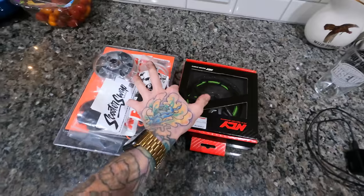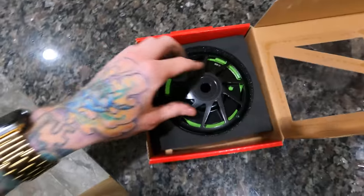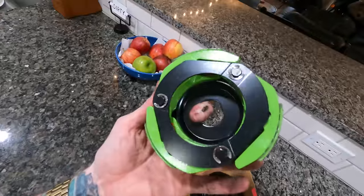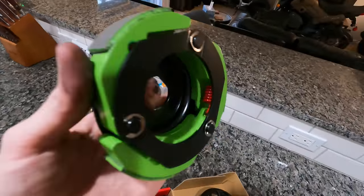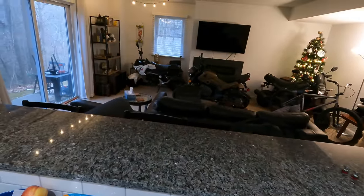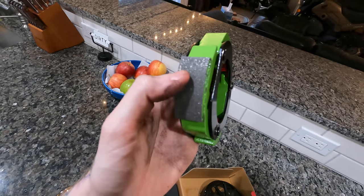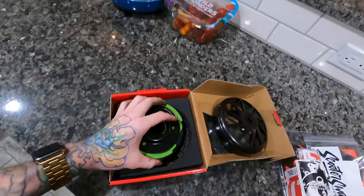Now let's check out what we're replacing it with. We got here the NCY upgraded clutch and bell housing. You can see that the bell housing is machined away, so it's much lighter than the stock one and it's also designed to grab much better. And then here you got the upgraded fancy NCY clutch right there. There are companies that make ones that are adjustable so you can adjust how tight the springs are and when it grabs. But I really don't know much about scooters and CVT stuff, so I figured I'd just keep it as simple as possible while still upgrading it. You can see this looks so much nicer, and just touching it I can tell it's much coarser than the other one — so maybe the old clutch was glazed.